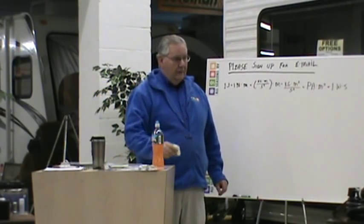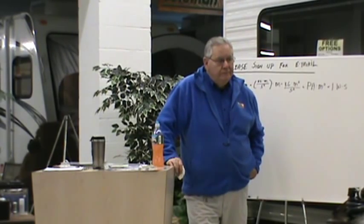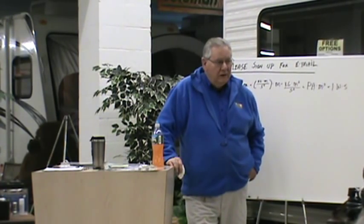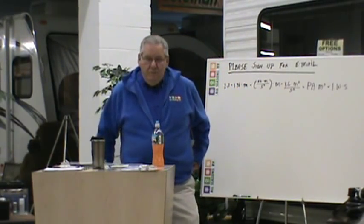We had friends that went out to a campground and they camped in the same area for years. One year they plugged in four units, each had their separate box. The ground wire was loose in the box. It blew everything out of all of the units. Refrigerators, converters, everything. And the campground says, oh well, wasn't our fault. Well, there again, that's why it's important to check before you plug in.